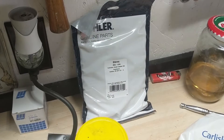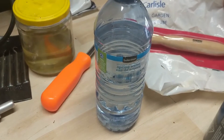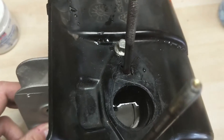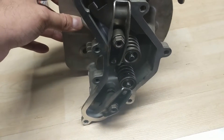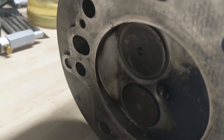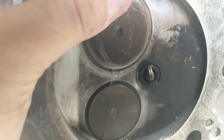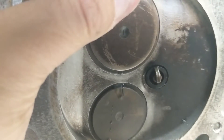I just got my head kit in - there's your Kohler part number - and I've lapped the intake valve. Now I'm taking some water and filling up the intake port to test the seal. I have both valves installed and I'm holding the cylinder head here - and we are leaking slowly. You can see it's beading out at one spot, water is definitely dripping out.